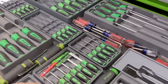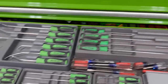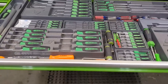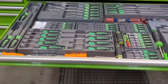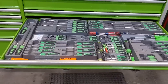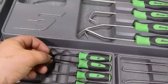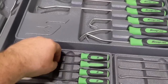These came in handy once or twice from my Snap-on guy. I use my picks a lot, and these interior pin poppers are hands down good — I don't really care the brand, I happen to have Snap-on here; at home I have Easy Red or GearWrench. Some people might say wasted space, I say clean and neat with everything I need in one spot. These they call spoons — I use them all the time for O-ring boss and O-ring face; just doesn't mess up the o-rings.